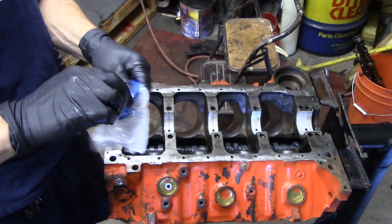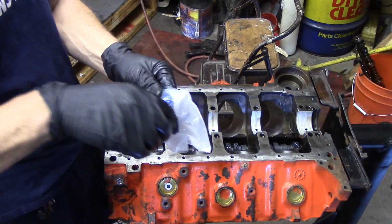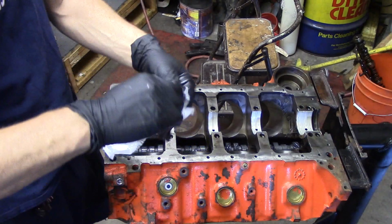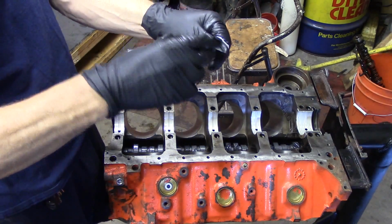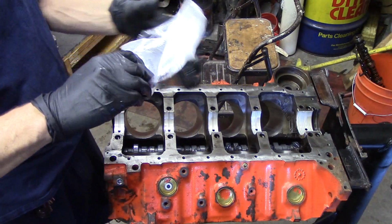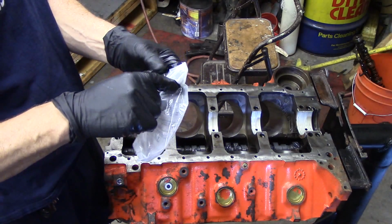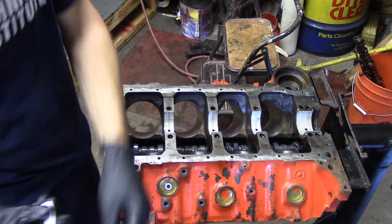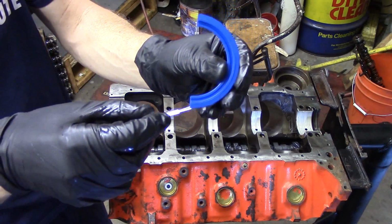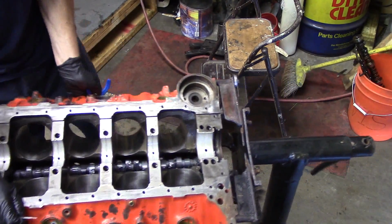we also want to put our rear main seal on. Now the rear main seal comes in a package, and this is a 2-piece rear main seal block. So we'll take our rear main seal out. The lip on the rear main seal actually goes toward the oil. In the seal package, there's this little shoehorn thing that's used for installing the seal. It's pretty important that you use this because it keeps the seal from being damaged when you install that seal into the block. So I call this a little shoehorn tool.